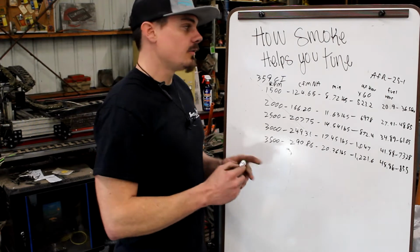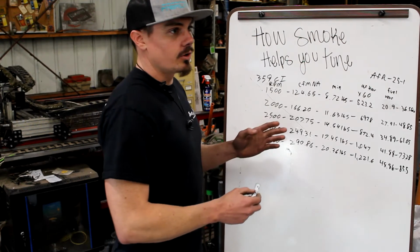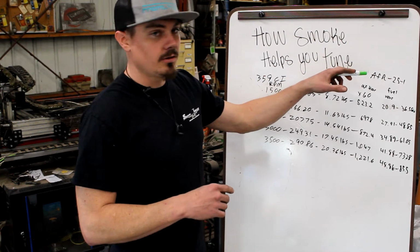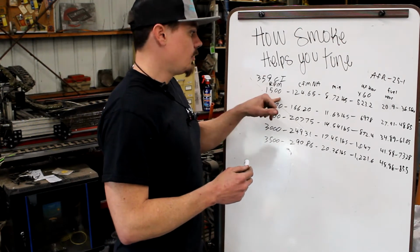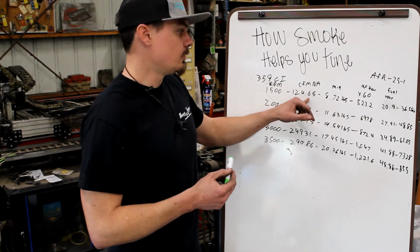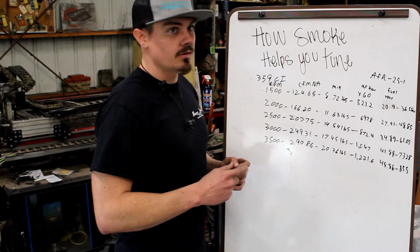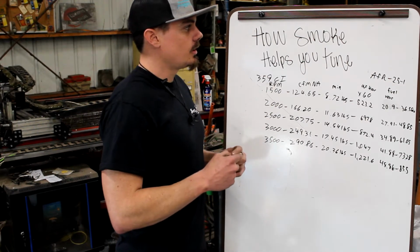and we want to be mindful of those things, because if we do the math, we know that we would not be able to attain the same 800 horsepower with 40 pounds of boost if we know it took 80 pounds before, unless some very extreme things occurred. Seeing as we're still on the same diesel fuel, it would have to be in the charge cooling system, and the engine would have to become overly volumetrically efficient, which we don't typically see in turbocharged engines. We normally will not see above 100% VE on a turbocharged engine, especially a turbo diesel that runs really high boost pressures. The VE tends to not get up to that. Yeah, so I hope that all makes sense. And we're going to get into our next thing.